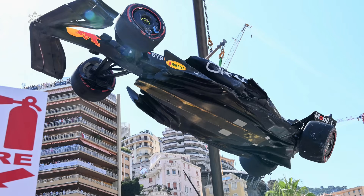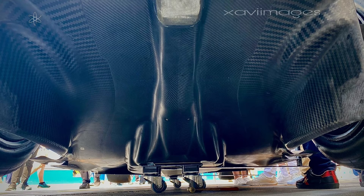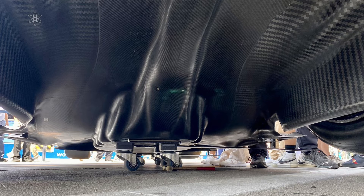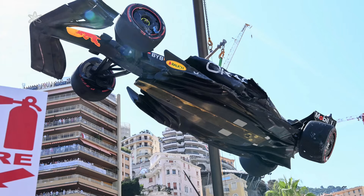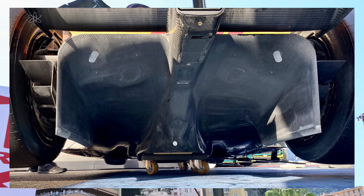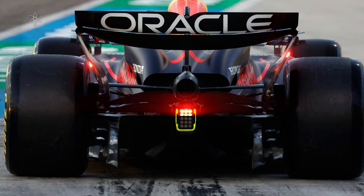The rear end of its central section also closes with little ramps going upwards instead of a smooth closing shape, and all the other teams have followed suit. This is clearly done to induce vortex, especially when the ramps are placed where the throat area is — where airflow is at its highest velocity within the tunnel — making for higher intensity vortex towards the tunnel exits. With the RB19, and also noticeable on later versions of the McLaren MCL-60, they even resorted to opening the throat area for a tunnel next to it. This compromises throat area performance via proximity to the ground for this vortex. One would think that as much cross section of the throat area closer to the ground would give the best performance, because the narrower the path the higher airflow velocity would pass this region and maximize low pressure, but it looks like they have taken this further.